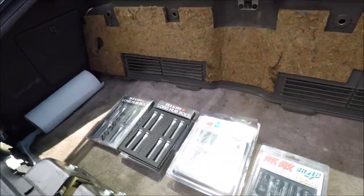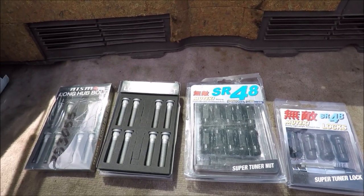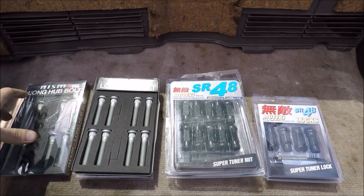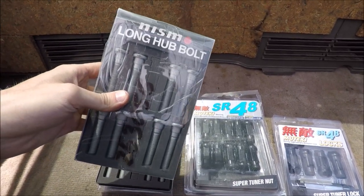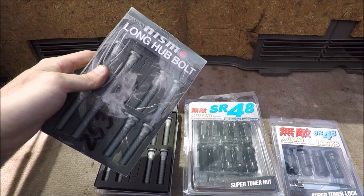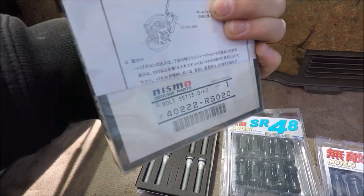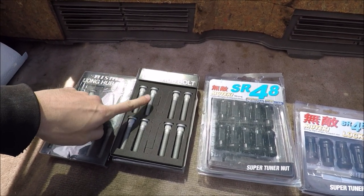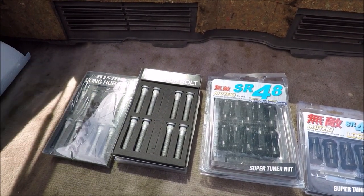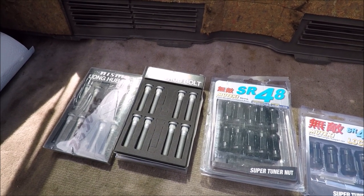And what we're gonna be using, I just have them up here. I went all out and I got some OEM Nismo extended studs. There are some cheaper options out there, but these are pretty important, and if one of them fails, then your wheel falls off, and I don't want that. There's the part number, in case any of you are interested. These are for the 4-lug models, like my car, but you can also get them with the 5-lug. I'll put a link in the description where I got these.